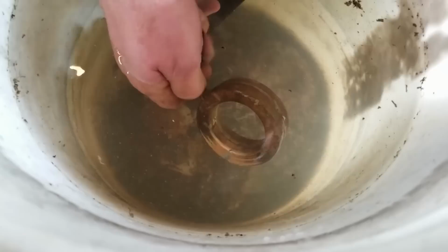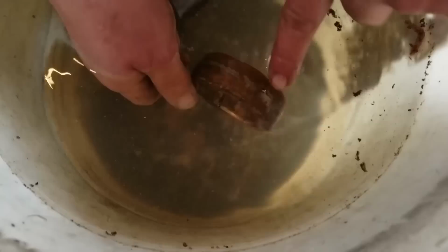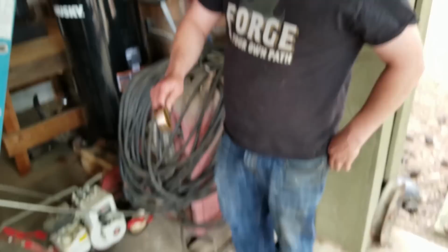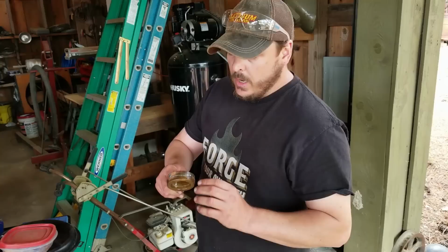It's just a little bit of solder right there. That's from the original time it was put together. No bubbles. That's why they don't make these out of brass anymore. Had real bad problems with them cracking, you know, that vibration. Brass will work harden, just like aluminum.